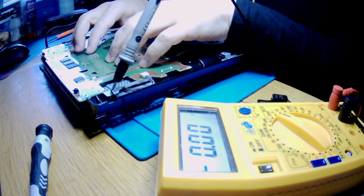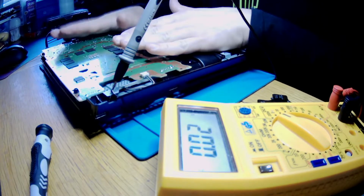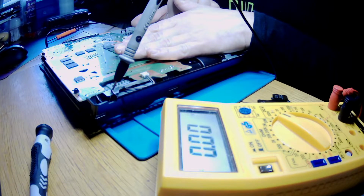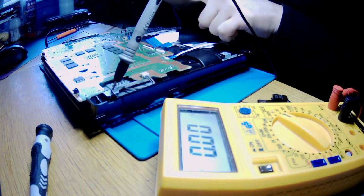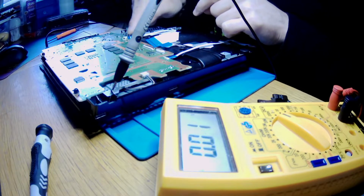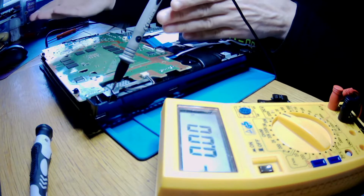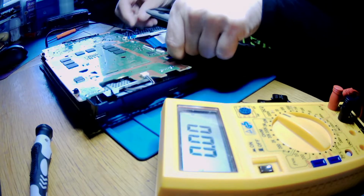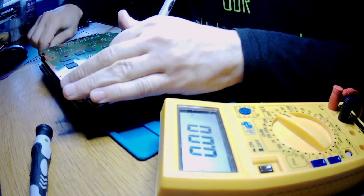So what I would have to do is take this board out, use our +5 standby voltage, AC DC standby, yes, ground, +5 volts, so this connector would have to be connected, and then I can use either bench power supply on those 2 pins which are going out from the main board to connect it, okay. So that's my next step.